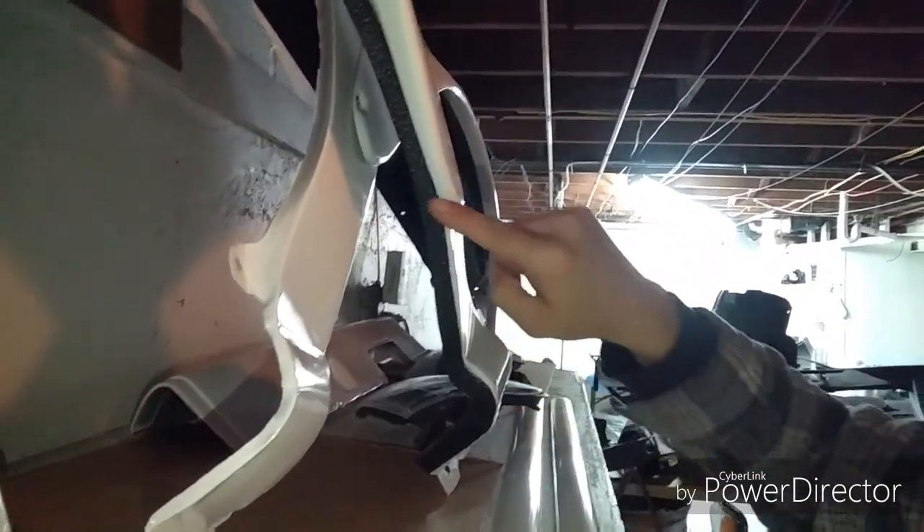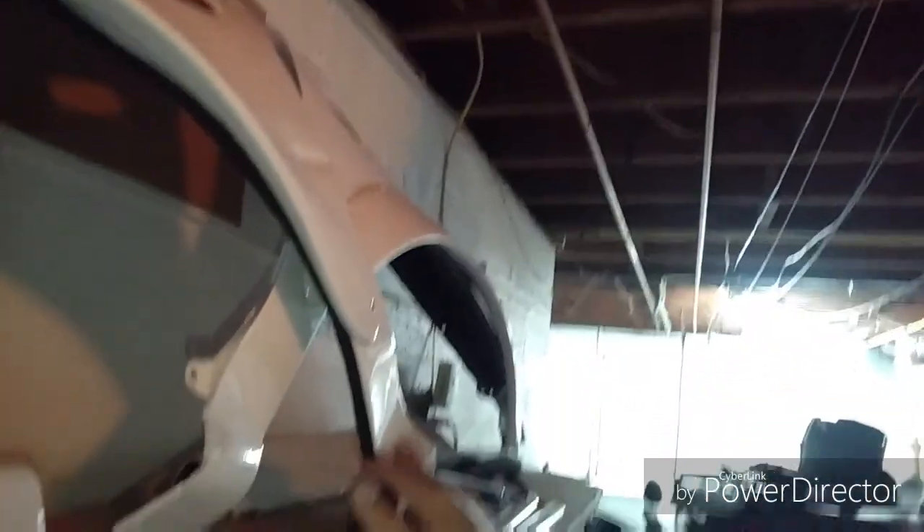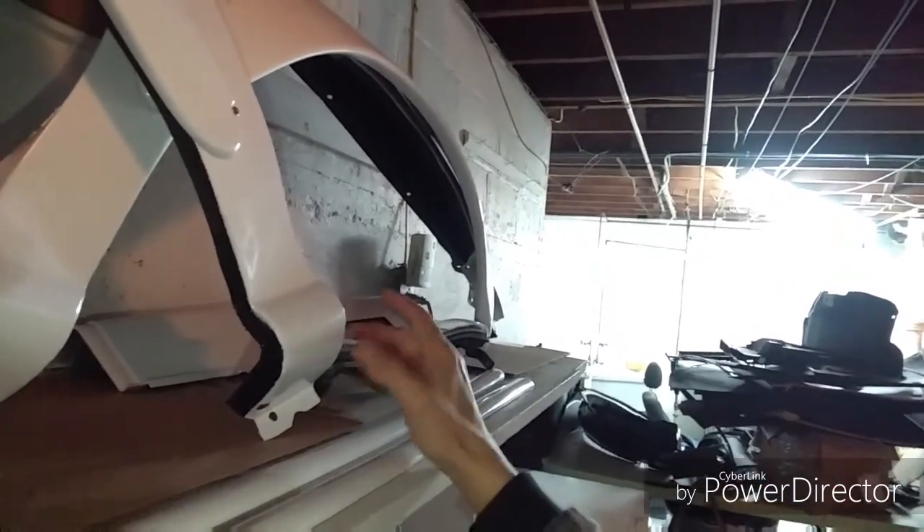You can see those are washers on the backers of your rivets. The reason you put washers on there is so you don't have any pulling or issues like that. You can see right here — this is the edge of your fenders. I put all this in bed liner, then I run my tape line down and paint over it. The reason I do this is because of rock chips. You'll see a lot of rust in GC bodies — the bottom of the fenders tend to rot out. They actually rot from the inside out, not outside in. A lot of the GC bodies have skirts and are kind of high off the ground, so they don't really get too much damage on the bottom.